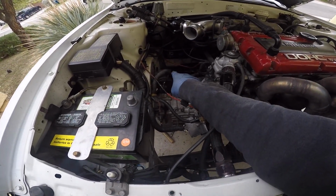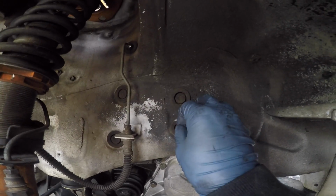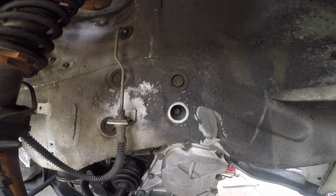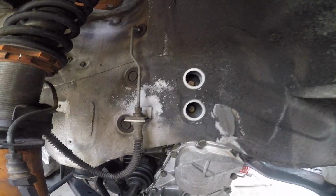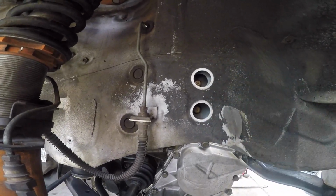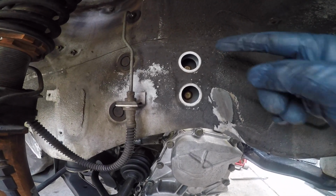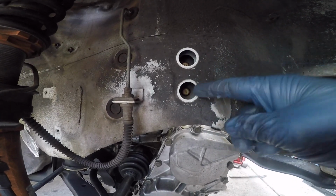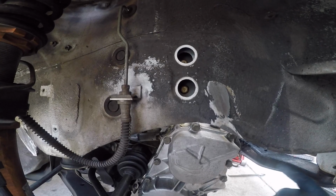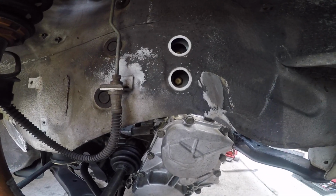And the mount, I forgot to mention the mount, guys, which I take off these little covers, and the mount bolts are right under these. So I remove the mount off the chassis and then drop the transmission, which you'll see it all from above, but just know when that mount gets loose up there, it's because I unbolted these after I loosened up the transmission bolts that go to the block.